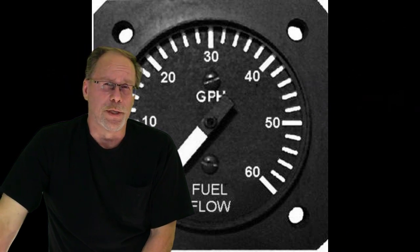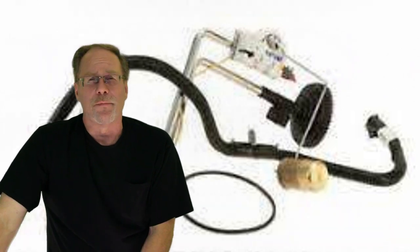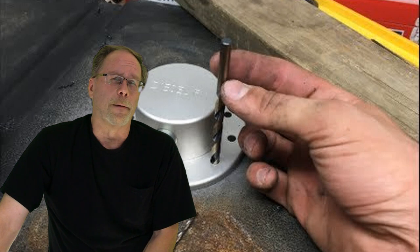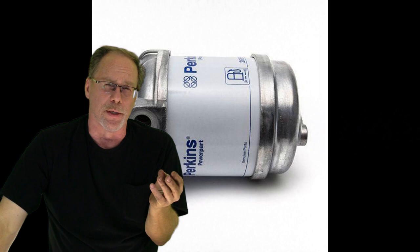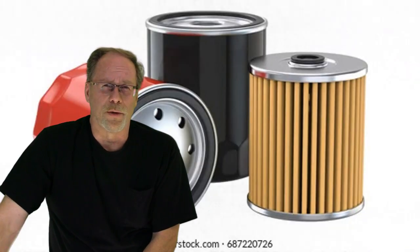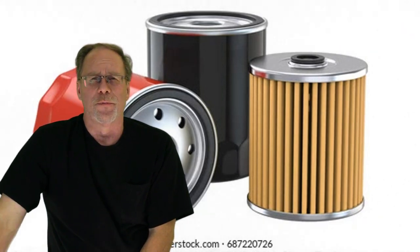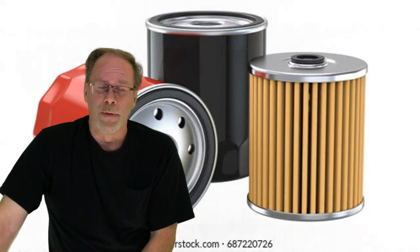You're really going to increase the amount of flow going to the pump. That draw straw pickup is under three-eighths of an inch, whereas with a sump you're going to have about a half-inch line leading to it. Keep in mind those two little filters on the draw straw are there for a reason, so if you're installing a sump you'll want to put in a pre-pump, pre-lift-pump fuel filter. A two-micron filter is more than adequate. The fuel filter will be installed on the frame where you can easily access it to swap it out — it's just positive the whole way.